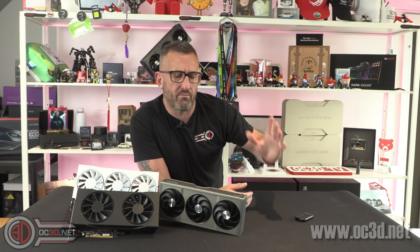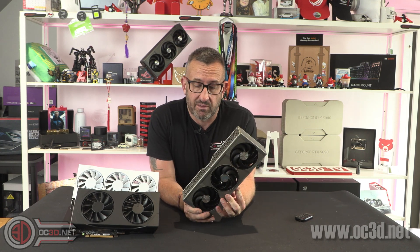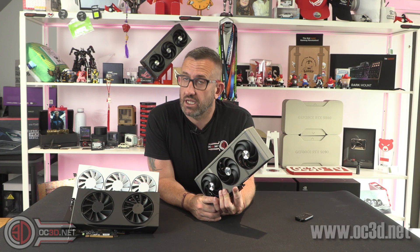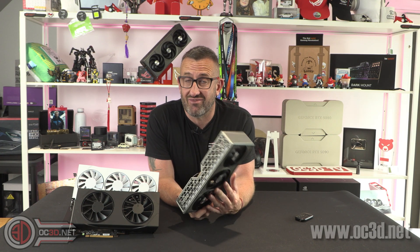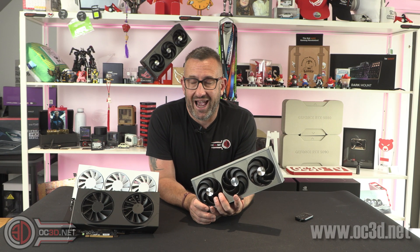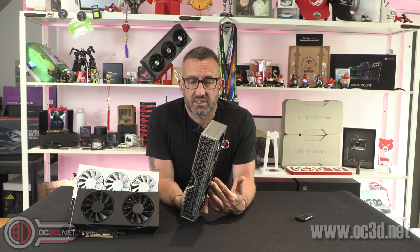People are now going to say, well Tom, what about coil whine? I didn't hear anything with these, but I seem to notice a difference with coil whine relating to power supplies more than anything else - and I don't mean the power supply is where the whine comes from, I mean the power supply causes the whine in the graphics card. I just use an AX1500i now and I don't get any problems. I very rarely get any coil whine unless you're in a menu doing 800 fps and it's just the poor card screaming because it's doing such a high frame rate.